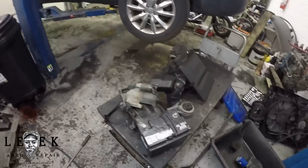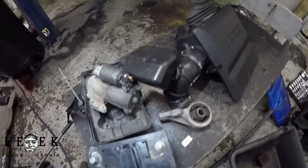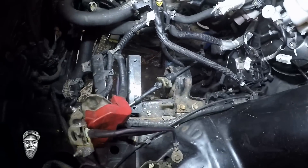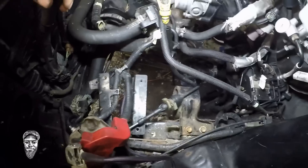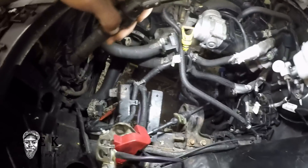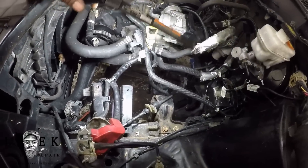The air box is already out, as you can see — parts are over here. I took out the battery and starter, the back mount, the air box induction assembly, and the battery tray. I left this little side mount right there. I removed the transmission bolts from the bell housing — I always work top to bottom, so I took everything out from the top first. The shift cable, and this dipstick — this yellow piece right here — is still in the car, connected to some type of clip, so I left that in there. I took off the connector and the cooler lines.